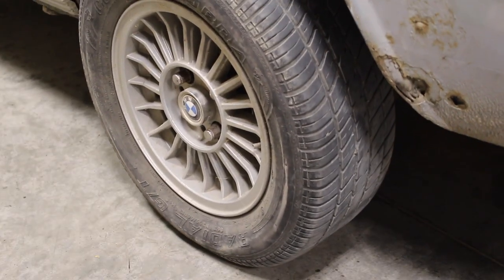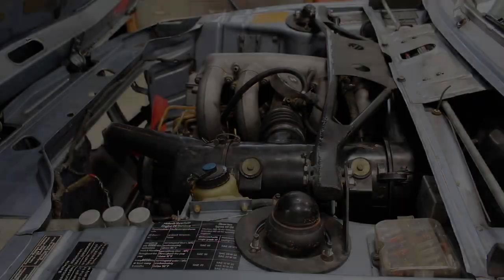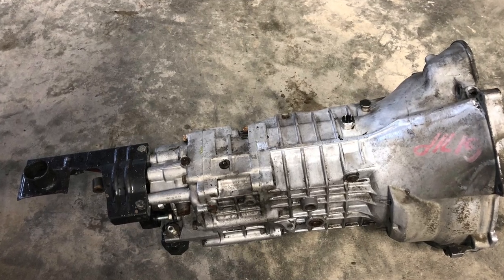When everything was hooked up, it was time to start it. This is where it gets interesting. It kind of sounds like the starter is only half engaging. My initial reaction was something was wrong with the starter, so I took it out, cleaned the brushes, gave it some much needed lubrication, and after installing it did the exact same thing. I was really wondering what was going on and decided to take the transmission off — maybe somehow the flywheel wasn't put on right or something along those lines. But after taking the transmission off, everything looked fine. So I put it all back together again and it did the exact same thing.